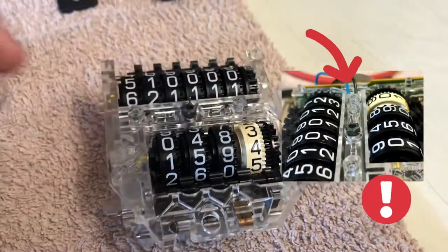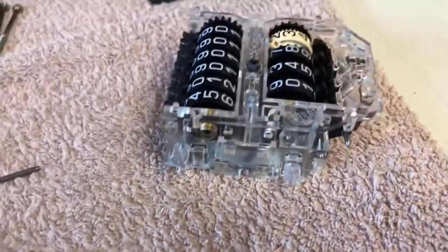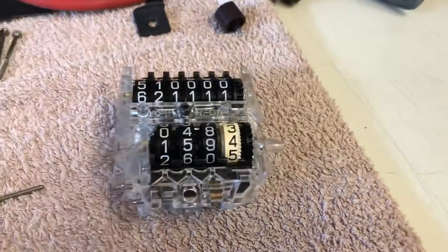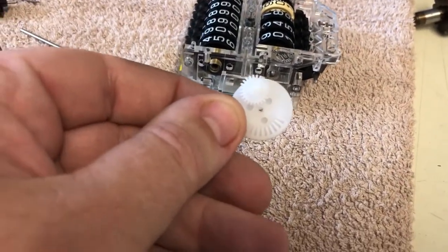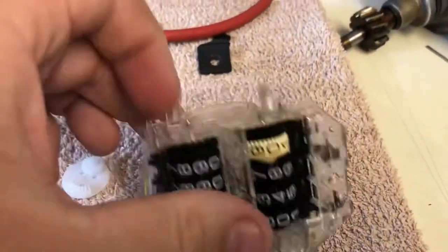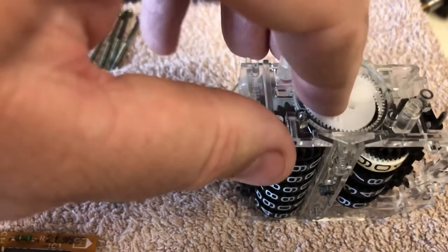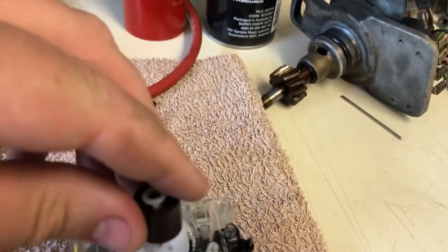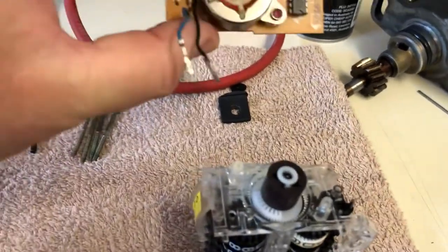Just be so careful - you've got that little needle there for the speedo and all the plastics, and you've got your lugs there for putting in your screws for the PCB. Take your time. I've set it up to roughly where the car should be - I've set it at five hundred and ten thousand. Now I'm going to put these little planetary gears in. I'll put that little cog on the big cog - there's a little locator for it - then just drop that in so it sits in place.